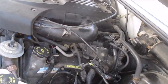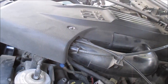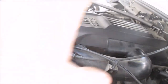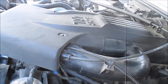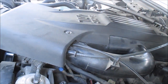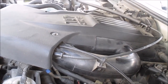There are a couple things you can do to find a vacuum leak. This one's not so safe — you can mist starter fluid, brake cleaner, or propane around your engine bay. If you have a vacuum leak it'll suck it in and your engine will rev. It's kind of dangerous with a hot engine, so if you're going to do it that way you want to have a fire extinguisher or something.